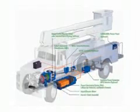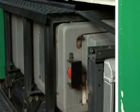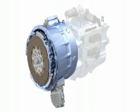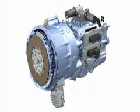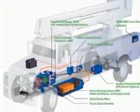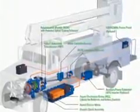The primary components of the Eaton hybrid power system are the power electronics carrier or hybrid battery box, inverter motor controller, AC motor generator, and an automated Eaton transmission. All hybrid power electronics are mounted by the vehicle manufacturer and can be in different locations depending on the make and model of the truck. Contact the vehicle manufacturer for component location.